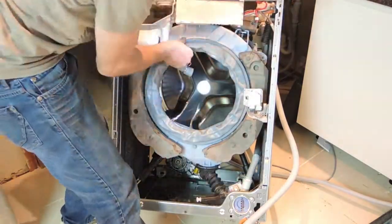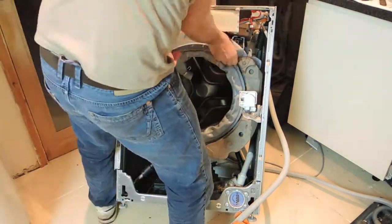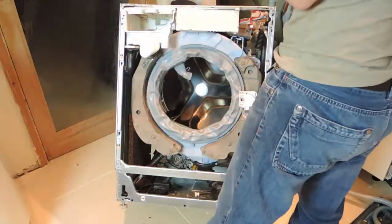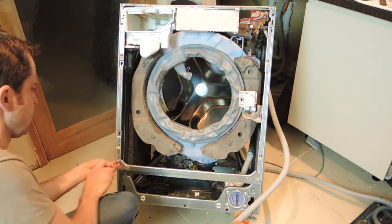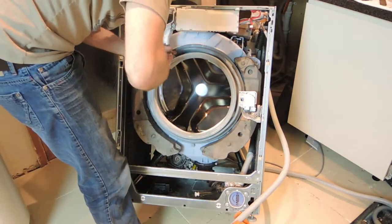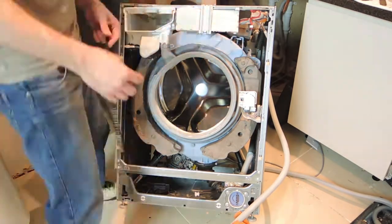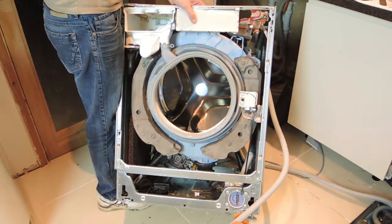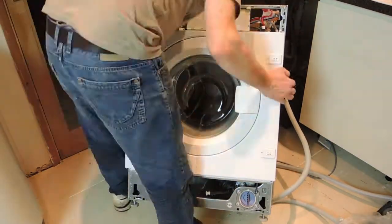The feed from the soap box gets fitted on, then fold the seal back in and tuck it back into the front. This is the wire element — I really struggled with this, but the way I found was to just gently ease it around. If you've ever done a motorcycle tyre, you'll know to gently ease it — that's kind of the way to do it. The front brace goes back on. Also note the emergency door open — that little black bit of plastic on the right-hand side: make sure that's accessible from the front once you've fixed everything else back on.